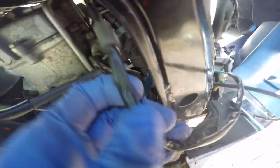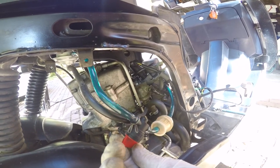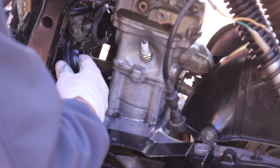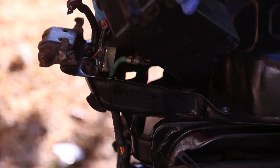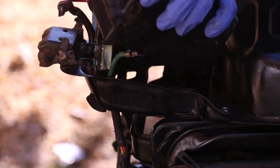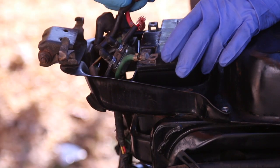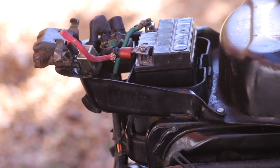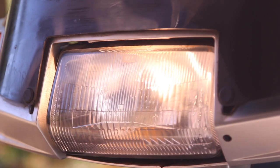I was wondering where this little tube goes - it's on the carburetor. It doesn't connect to anything other than the carburetor. We're going to take a piece of brand new hose and cut it right about here like a U. It's kind of good to renew all of this stuff. This line is the enricher. I believe this is not stock - it's a little petcock thing, which is a good idea. Here's the throttle cable. Alright guys, I have the battery in. Let's turn the key and see if we have light. And there is light - high beam, yep.